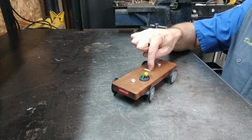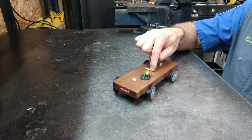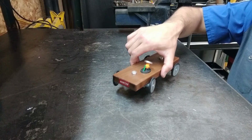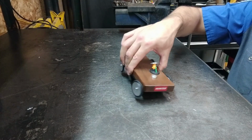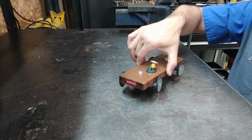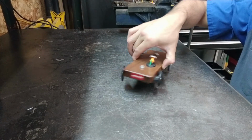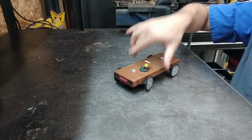That sensor is known as the yaw rate sensor, and it's usually measured in degrees per second. So degrees per second would notice the difference between this movement and this movement. So degrees per second is determining the rate at which the vehicle is rotating around that center axis, the vertical axis.